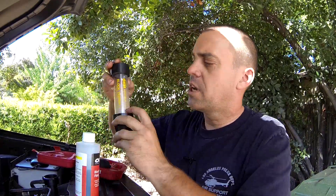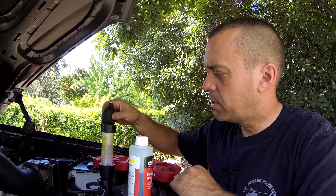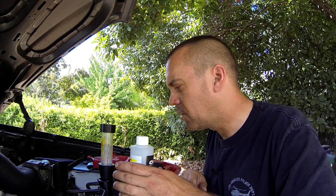It's really easy. What you do is you fill this up to this line here, stick it into the radiator, then pump this here to draw gases up through the fluid. If it stays blue, you're good. If it turns yellow, you have exhaust gas — combustion gas — in your coolant, which means you have a leak in your head gasket somewhere, and that's not a good thing.